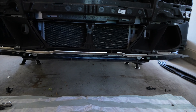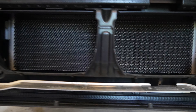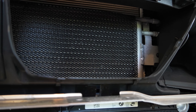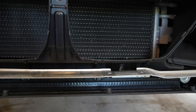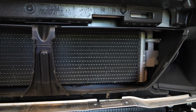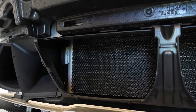Since I'm already here and the bumper is off, why not go ahead and do that? So what I did is I fabricated a piece of aluminum mesh to fit. I did 22 by 7 as the measurements — that seemed to be the right dimensions to make it really clean, going flush on the bottom, right outside the body all the way to the top. So it's super clean, looks OEM. It's a four-by-four rhombus design, so nothing is going to get through at all. I used heavy-duty zip ties — thin but hyper-durable UV-resistant type — to hold them on. I thought about steel wire, but there's no good place to do it, and the heat here isn't high enough to where a plastic zip tie would be an issue.